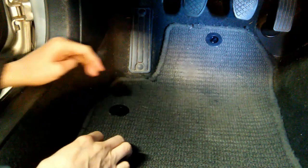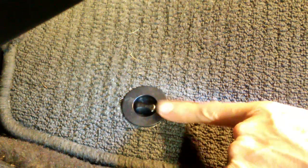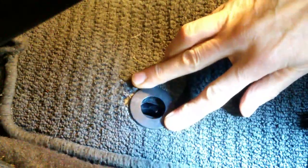Now we look at the next one — with the car mat in the car, the needle piece, and the carpet piece inside the floor mat piece, just to line it up. We pull this back out of the way but keeping it in one position. That's the final resting place where we want it. Keeping in mind that needle is three centimeters long — one, two, three centimeters — we dig that needle in and slide it three centimeters forward. That should just about line it up. There it is, pretty much lined up. Then you turn this little piece and that locks it into place.